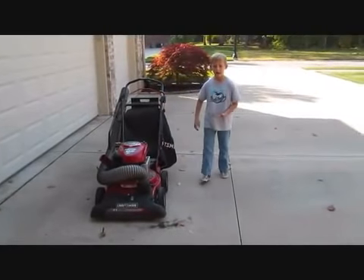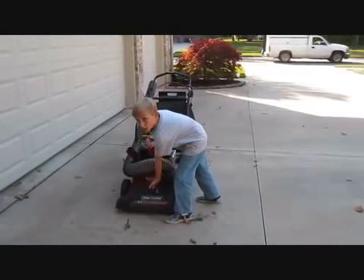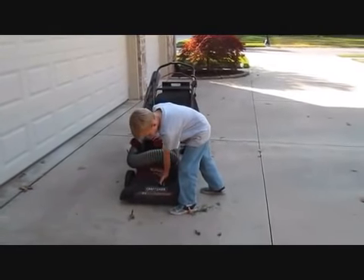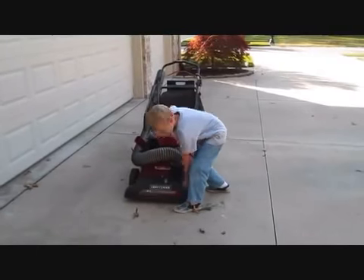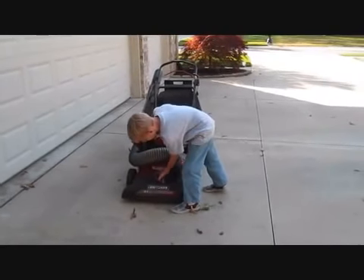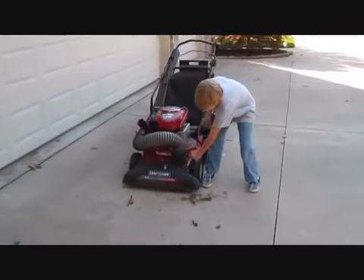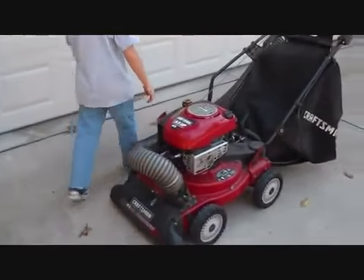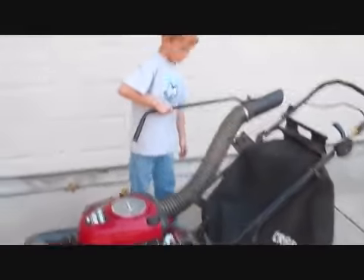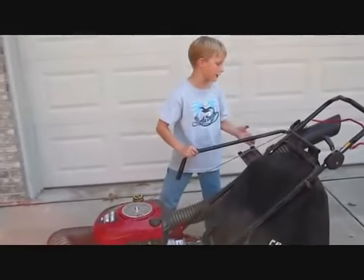You can basically pick up anything except grass that's in your yard. This right here is your switch to switch it from the nozzle vacuum to the hose vacuum. Just pull that up, pull in this lever and push the tube down. After you've done that, just pick it up. You've successfully changed it to the tube vacuum.